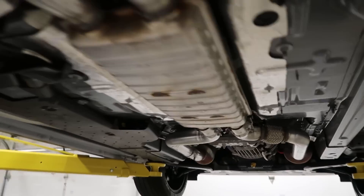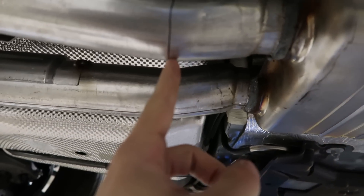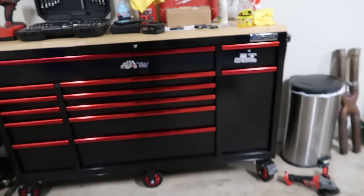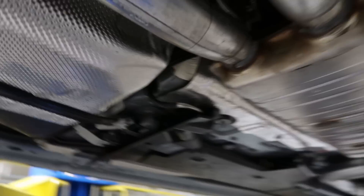I'm going to cut everything off under here, throw that sucker right on. So my car was pretty much the guinea pig on doing this. Right where the pipe starts to bend, I'm going to cut it right before that sharpie mark, just to be safe. This blade right here — this saw — will cut about halfway through the pipe, probably right to where that line ends.